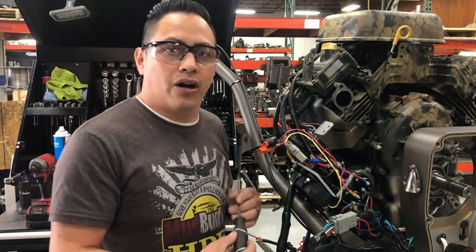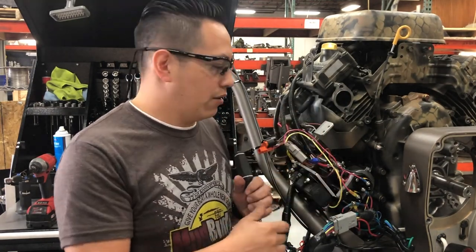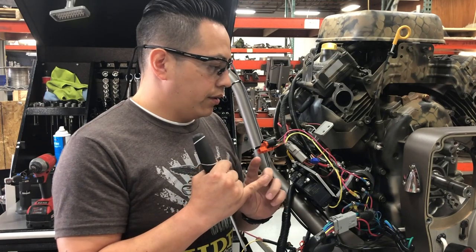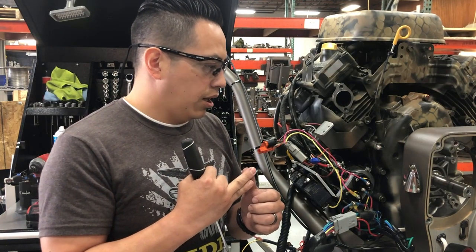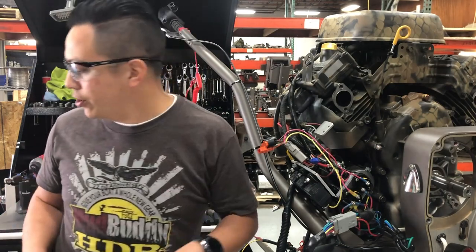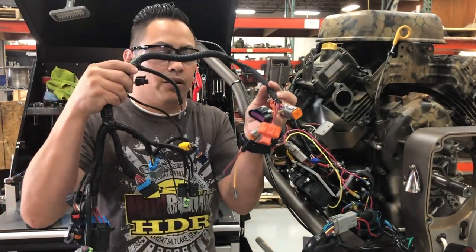This is the HPR 50 I have mounted right here. I don't have a transmission, I don't have any of that. Two things I've noticed the most: transmission wiring and your kill switch. Those two are the most important things, and I've received a couple of emails from people who don't know what to do with them. Let me show you a brand new wire harness — this is how it's going to come out of the box.